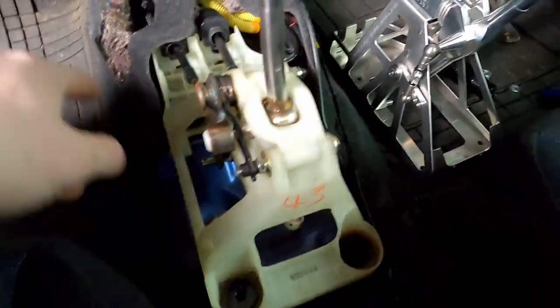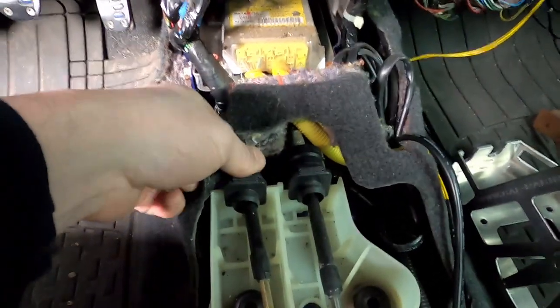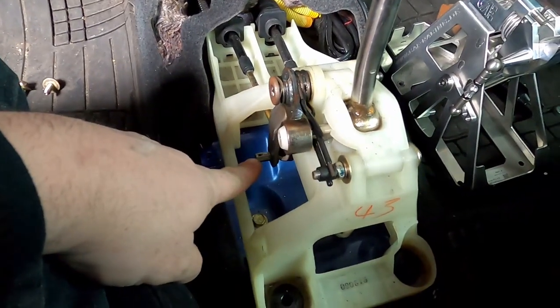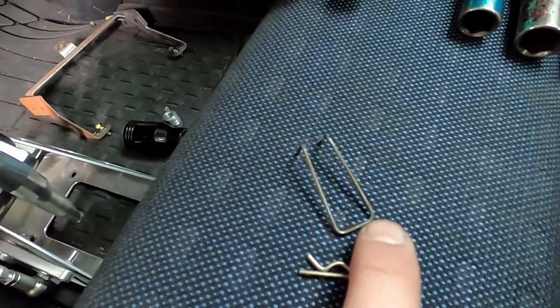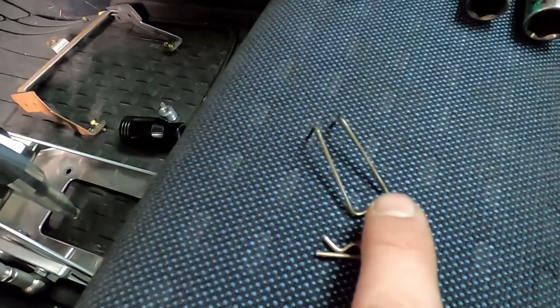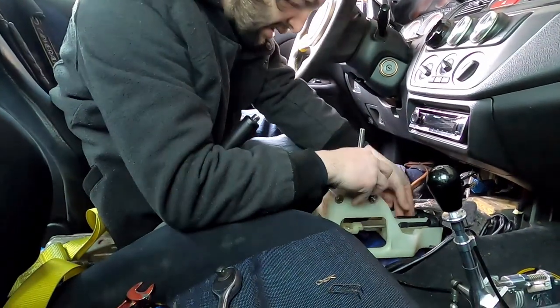Got these bolts out, this little metal guy out, and then these linkages — all you got to do is just pull them up and they come out. You need little pliers for this one, and this guy that goes on the bottom one just kind of wraps around — nothing crazy to pull out. And then you got those bolts down there; those are 12mm. The ones over there on that middle piece are 10s. I'm going to now pull this out — I dare not do this one-handed.